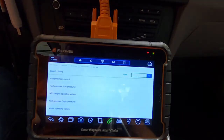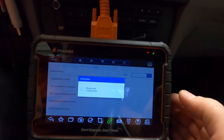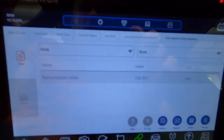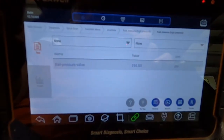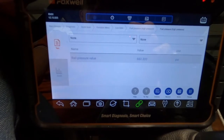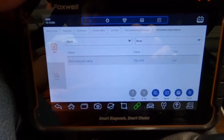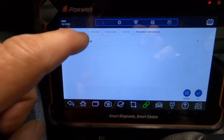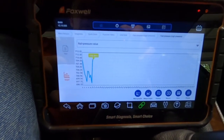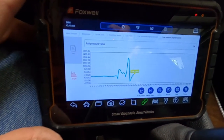You can go look at live data. The fuel pressure is what we're looking at — the high-pressure fuel pump is what would cause that code to come up. Let's look at the rail pressure. Zooming in, we've got about 750 PSI on the high-side pressure for the high-pressure fuel pump. Rev up the engine and it's going up to 1,200 PSI, so we've got good pressure out of the high-pressure fuel pump. That's just an example of the live data. You can also graph it out with this scanner to see what the rail pressure is doing in real time.